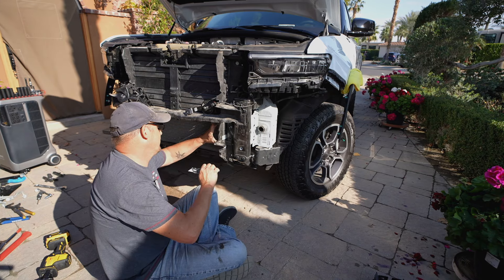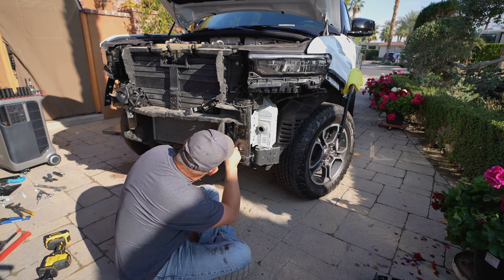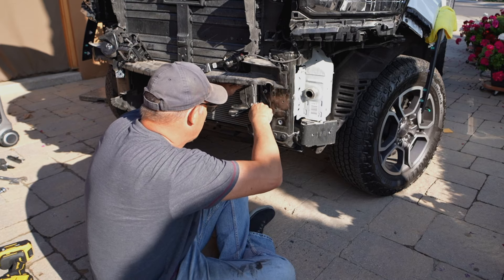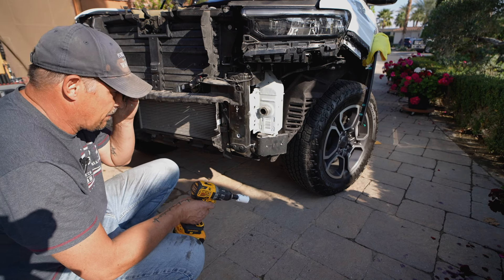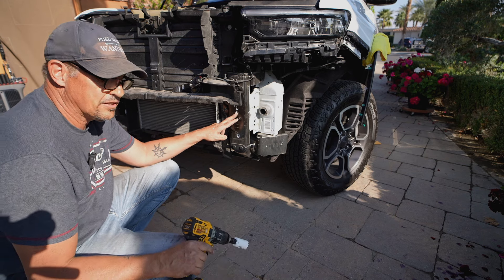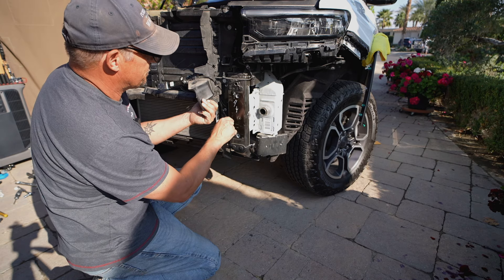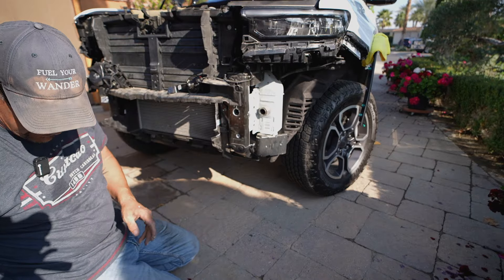So now we need to trim this plastic piece — probably airflow for the radiator — so the base plate will fit. I've marked it with a white pen and will cut it with a box cutter and a pair of snips to trim it out. Get that side piece cut, bend it back — pretty straightforward. And we've got that on the driver's side; same thing on the passenger side. Now we've got to make an access hole — we'll use this later when we put the bolts through the frame to attach the base plate. This is a one and a quarter inch hole saw, exactly four inches down from the top of the frame mount to the center. Hopefully quickly drill a little hole — right where we want it.